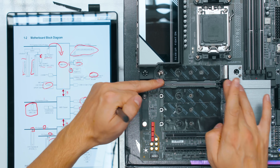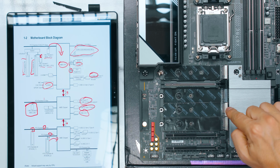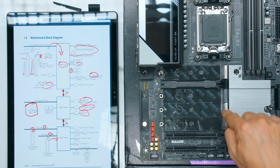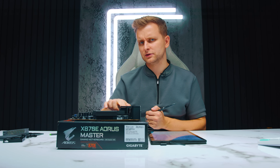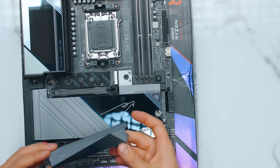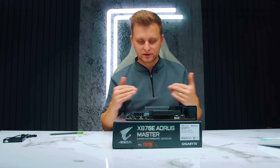So if you've got anything plugged into the expansion slots, nothing will change. The only thing is when you plug anything into the third or fourth M.2 slot from the top — slots B and C — you're going to start to lose some GPU PCIe lanes. But putting the heatsinks back is very nice. I love the easy installation for M.2.